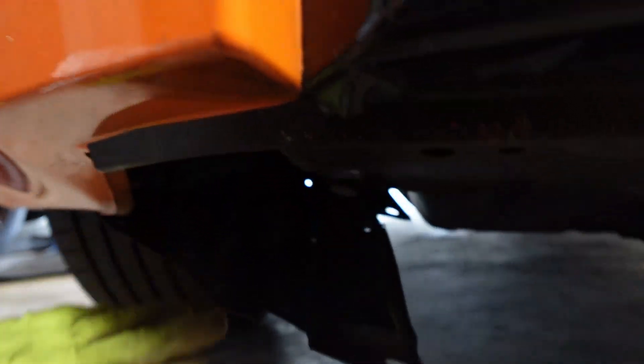We're on the passenger front side of the car. I pulled this trim down with a couple 10mm bolts and that right there is what we need to replace. We're gonna unplug it and then pull it out. This rubber grommet is keeping it in place and I'm gonna have something underneath to collect all the washer fluid that comes out. Then we'll swap it with the new one and plug it back in.